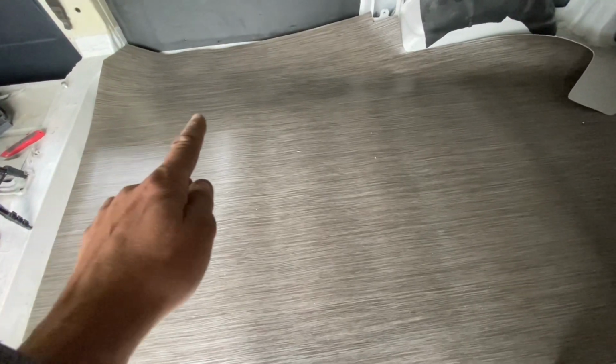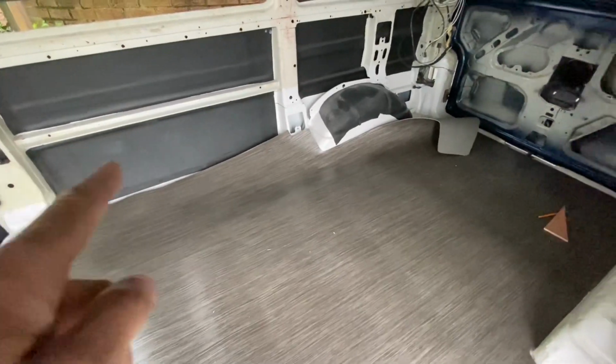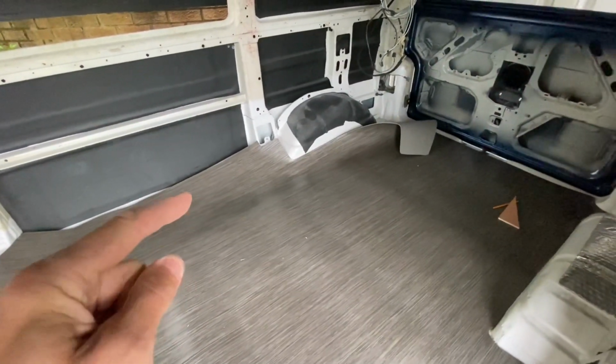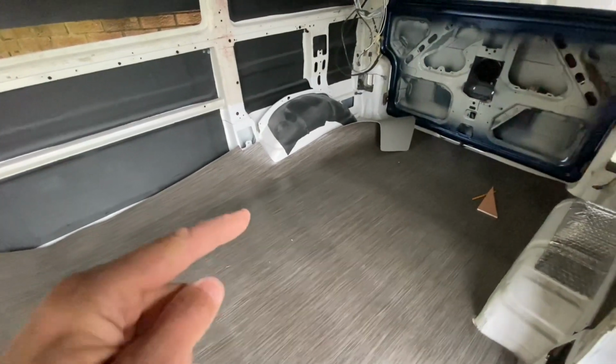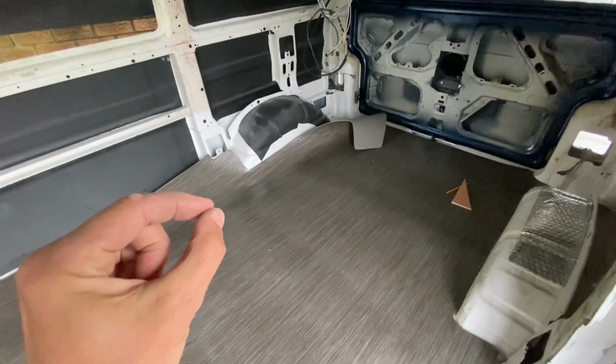So what I'll do is put this vinyl floor over there, cut round it with a Stanley just like I did with the other side, then overlay this vinyl floor. So I'll mark the side there and there where the ply lining stops along under here. Then I'll line those marks up with the edge of the other sheet of ply and then draw around it and then cut it out. And then I've got two manufacturer's cuts that are perfectly straight, rather than scribing one in and then trying to cut the other one to match that one. Otherwise I end up with a wibbly wobbly cut. I'll have two manufacturer's cuts that sit perfect together.